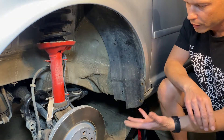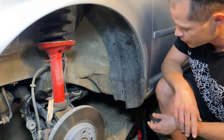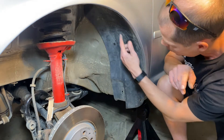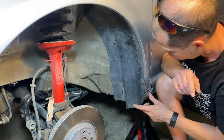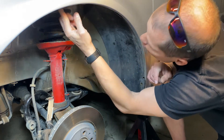You're gonna need to get the vehicle front end in the air and get the front wheels off — that's on you. After you get in here you're gonna find a bunch of Torx screws holding the front fender liner in place. You just have to find them all — there are six of them.